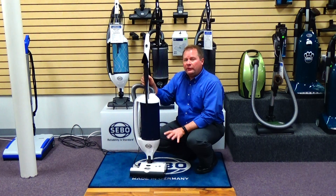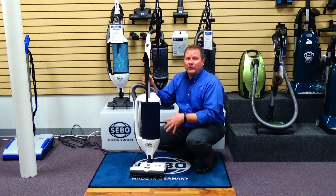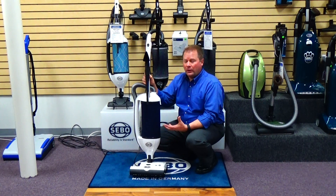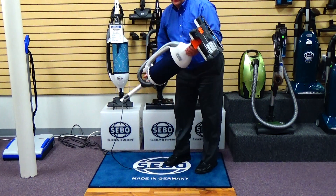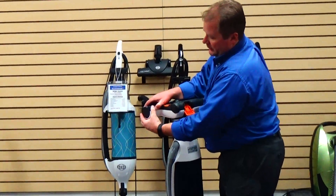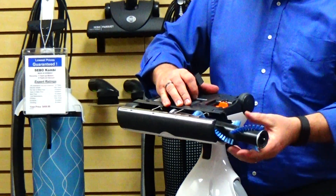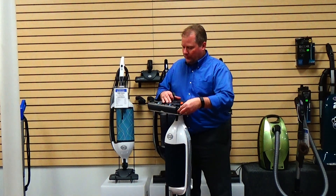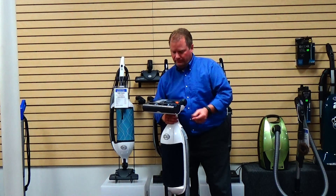The last thing I want to show you is how nice and easy it is to clean hair out of the brush roll. One of the most annoying things my customers tell me about is when they have to totally disassemble their head to get to the brush roll to get all the hair out, whether it's pet hair or long hair from people in the house. To clean out the hair in the brush roll, simply turn the machine upside down — there's a little button here that you press in, twist the end cap, and twist the brush roll a little bit so it disconnects itself from the drive shaft. You can pull out the brush roll and very easily remove the hair from it. Simply reinstall the brush roll and end cap, click it down shut, and that's all there is to it.